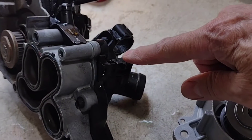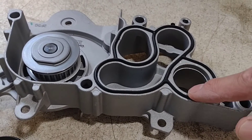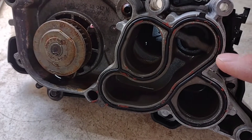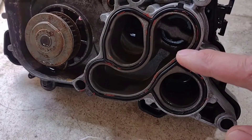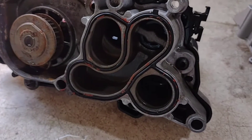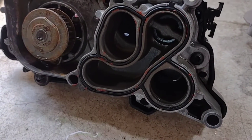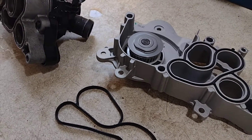The one for the manifold as well as the wiper seal that hooks up to the block. This has a very strange way of sealing — it actually wipes along the side of a flat machined section on the block. It's almost impossible to take off. Even at 70,000 Ks, it tears slightly because it partly welds to the block, so it's very, very difficult. I don't think it's a reusable part because of the bonding to the block.